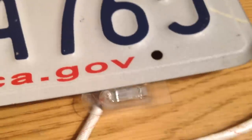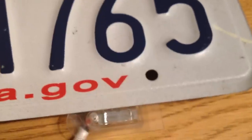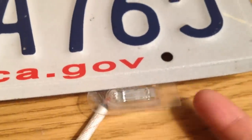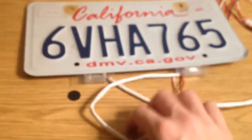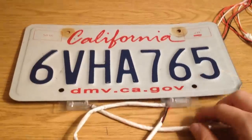The way they're designed, they're designed for Asian or European plates. If you look at American plates, they've got circles on the bottom for the screws. In European plates there's a little rectangular opening right there — it's a little bit wider, and it's designed to accept this little photodiode right there. It does stick out a little bit, and then the flash head as well. So it's designed to actually go back behind the plate, but on American plates it doesn't fit right. So what I've done is literally just grabbed some super glue and super glued this top part right there to the back of the plate itself. So that's how I've got it applied, and then the wires would run out who knows where. I haven't actually put it on a car yet permanently.